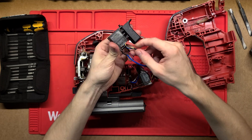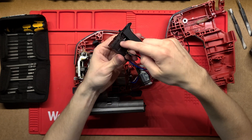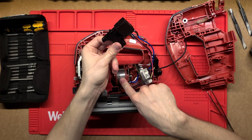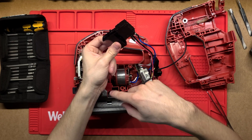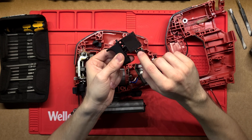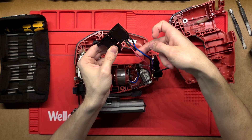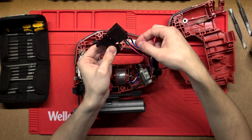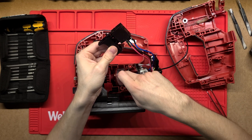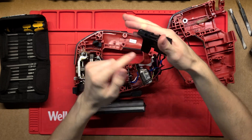There's another cable here for the potentiometer in the trigger — it'll have a little wiper and depending on its position it changes the resistance, which the computer measures. Because this is a brushless motor, it'll have some MOSFET transistors that turn the motor phases on and off. There's also a nice big diode in between the battery terminals — when the trigger is released there's a strong back EMF current from the motor, and that diode just stops it from going back into the battery and damaging anything.